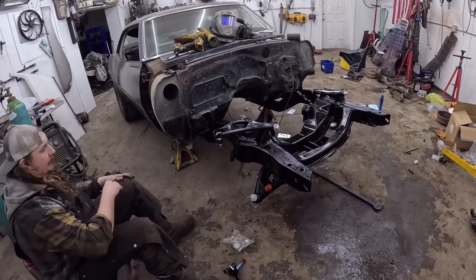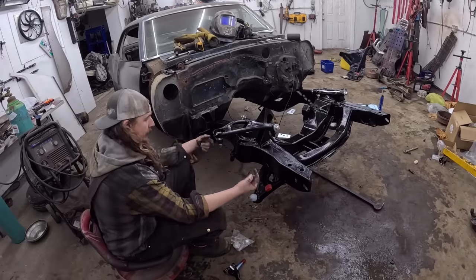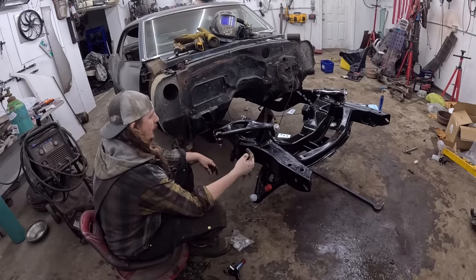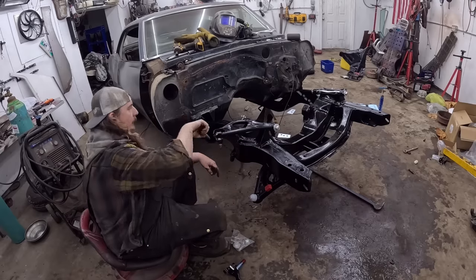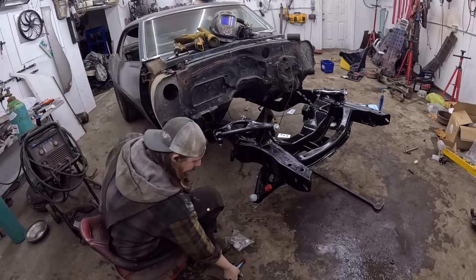All right. Let's get after this. So I hung the lower control arm and literally just put it in. This one went super easy, two bolts, you're done. Originally this thing came with the bolts going through the cross member, which is a bit of a hassle. I put them through the other way. I can't see it makes a difference, because it's easier to hammer them in.